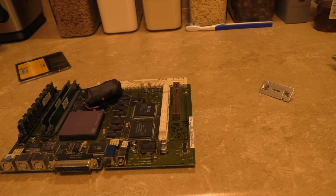And it turned into a lot of Mac Classic owners running their motherboards through a dishwasher, which can temporarily cure the problem. But again, with capacitors failing, there are two problems, in fact, not just one. Number one, you have electrolyte, which is conductive, leaking all over your board. And number two, your capacitor is starting to drift in value. And both of those can cause problems in outright system failure.